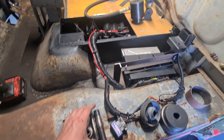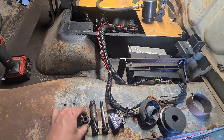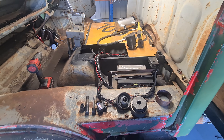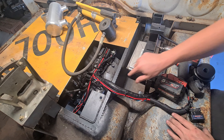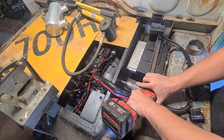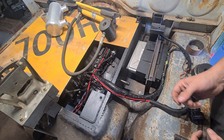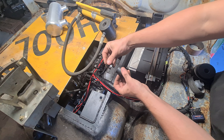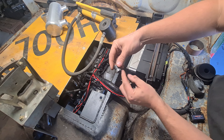To start with you need to drill a small hole. I normally drill a really tiny hole, get this bolt through there, then use a small cutter to make it the right size, and then use that to go through the wall. I'll set up the camera and show you how to use it. So you're looking from a top-down perspective here. First I want to drill a small hole big enough to receive this bolt. Then I'm going to screw the port-a-power into this, put the die either side of the metal with a nut on top, pump the port-a-power up, and that will pull the two fittings together and cut a clean hole.